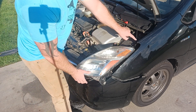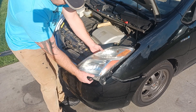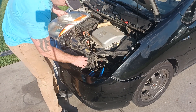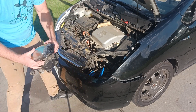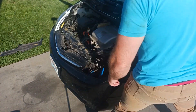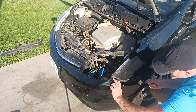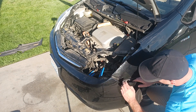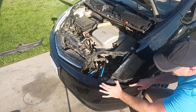You're going to have one bolt over here for your headlight. You're going to have another bolt behind here after you remove this clip and this bolt. You will have a bolt right here going up, and one other bolt here. You don't have to remove the complete bumper — you can see it flexes slightly, which is enough room to remove the headlight.